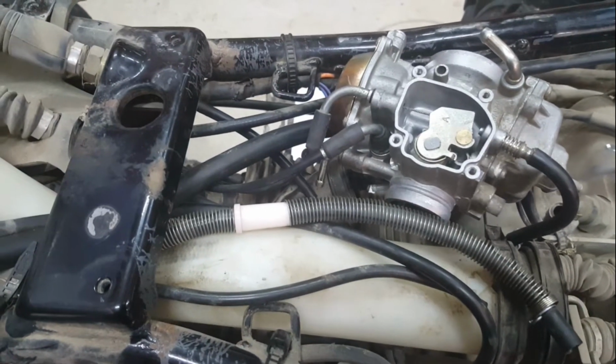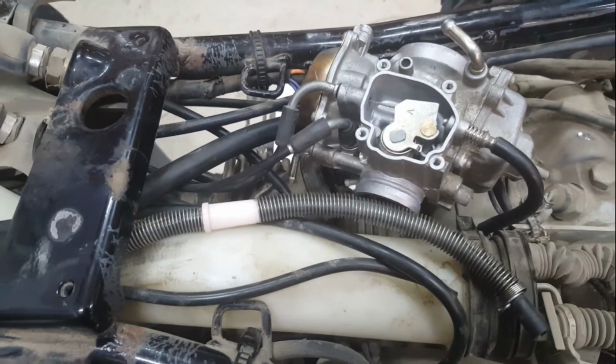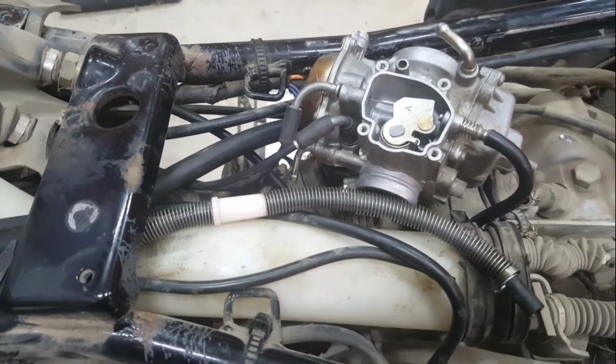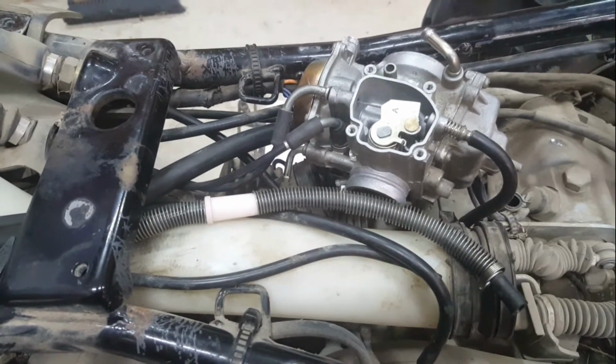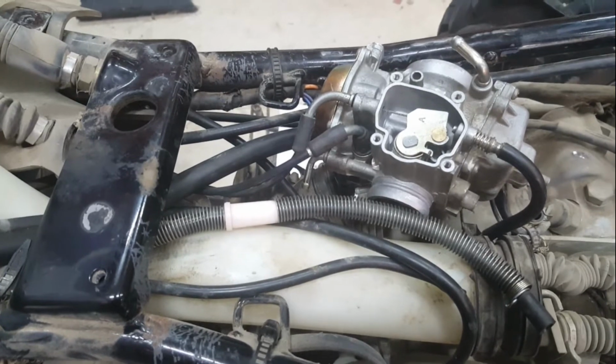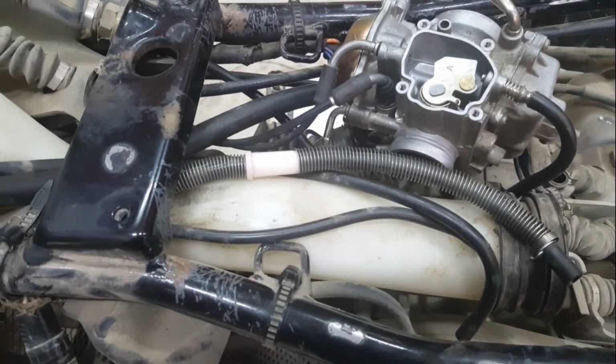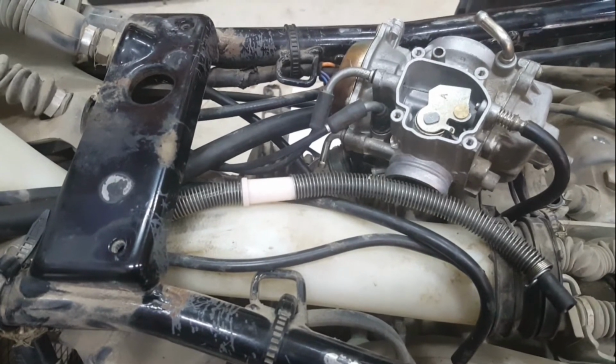Continuing with hooking up this carburetor for a trial run. That's the throttle cable and the choke attached. They're the more difficult ones. Now I think they've got 3 vent pipes or pulse pipes and things to put on and a fuel line, and I've got to slot it into the intake manifold.